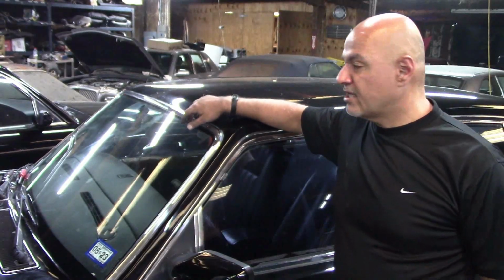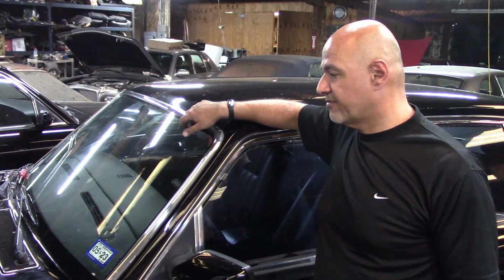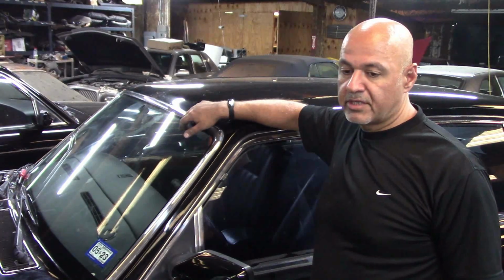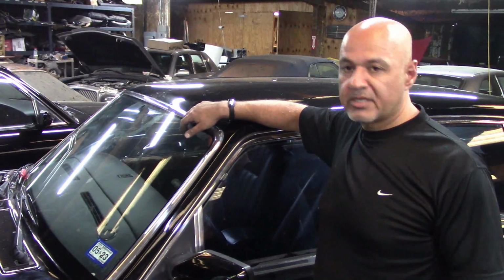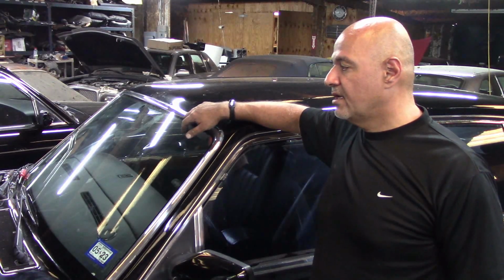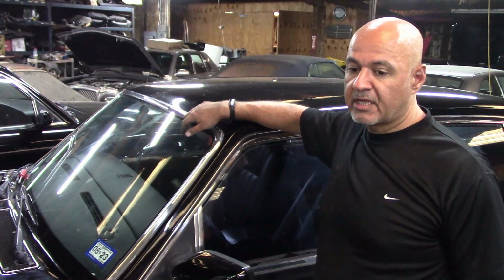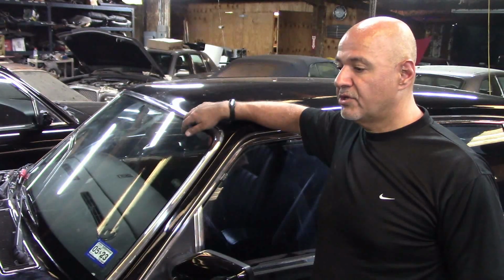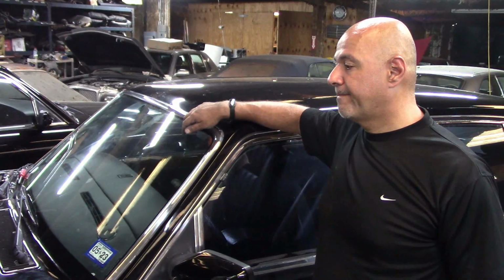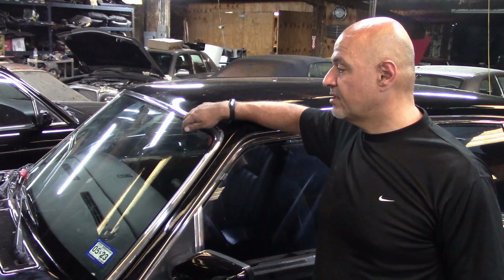I don't really understand all of the diagnostic systems on this car. I've got the scan tool. The scan tool's reading the O2 sensors. The O2 sensors are bouncing up and down for like 5 minutes, like they should, and then all of a sudden they peg out at 1.27. The fuel trim acts like it's being dialed back. It's in the negative numbers, which would indicate that the computer is trying to dial back the trim. So I'm not sure exactly what the deal is.